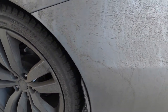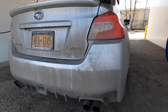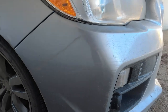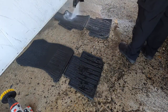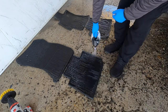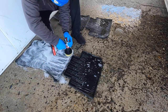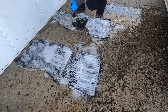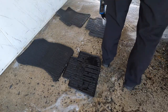We're down here at my favorite self-serve car wash, just a few miles from my house. You can tell the WRX is absolutely thrashed from the snowboarding trip to Vermont. The first thing is taking the mats out of the car — I have the rubber all-weather Subaru mats and we're just going to get these rinsed down. They have a gun that comes out of the brush but I'm just using it for water pressure. I've got Super Clean degreaser at full strength in the pump sprayer, so once the mats are rinsed we soak them, then use a medium-stiffness drill brush to agitate and loosen up all the dirt, salt, and winter road grime. Once scrubbed, give them a simple rinse and set them to the side.